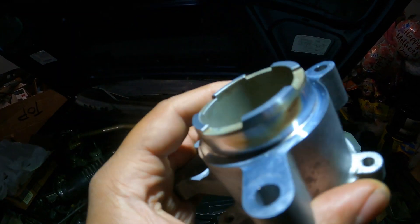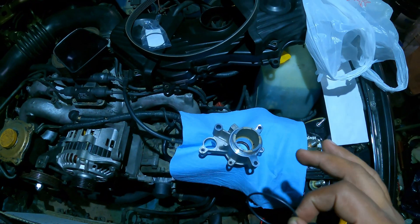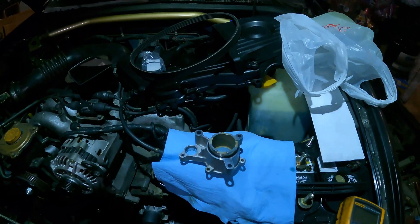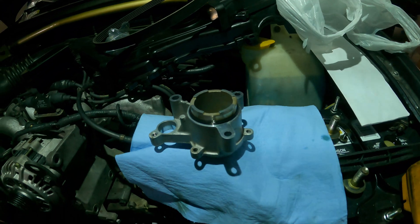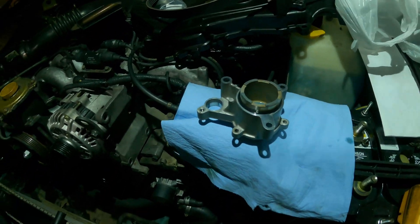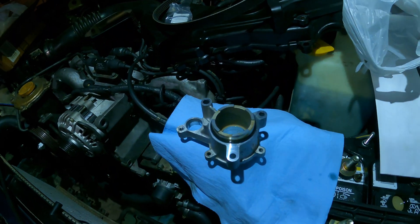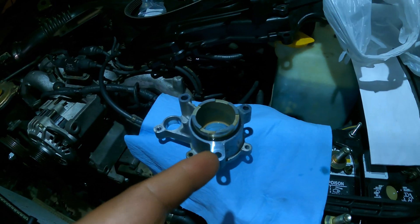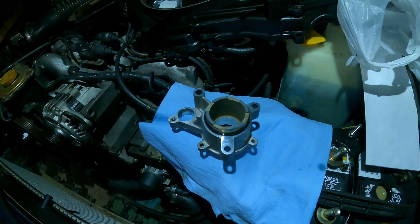Moving on to the back side — I have a new seal and I'm just coating it in oil, lightly rolling it over. You want to make sure you clean the part — I put it through a parts washer. Use a light cloth or microfiber, not anything abrasive like a bristle brush or sandpaper. You don't want to mess up the mating surfaces, especially on a part like this that may no longer be available from Subaru. Just dip your finger in oil and lightly coat the entire seal, then slowly fit it to the part.